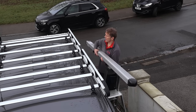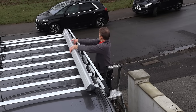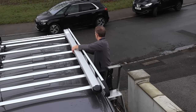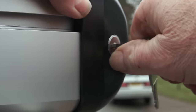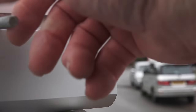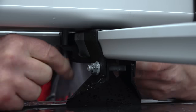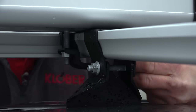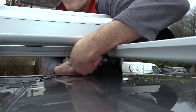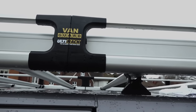There's a tube carrier with a special lining inside so you don't scratch your conduit — it's really for electricians. You can get the unlined version for plumbers, but I've got the lined one. It'll be tucked in beside that rail, which will leave room for eight-by-four sheets. That's the rear lockable flap. The fixing bolts slide into the channel — four of them, two bolts front and two bolts back — and a couple of top hat brackets go around the rails. There's the top hat bracket that goes under the track. Put the nuts on, torque it up — that's the tube carrier on, everything's in position.